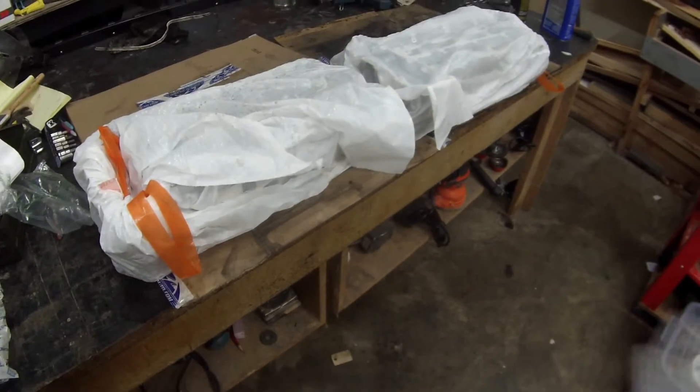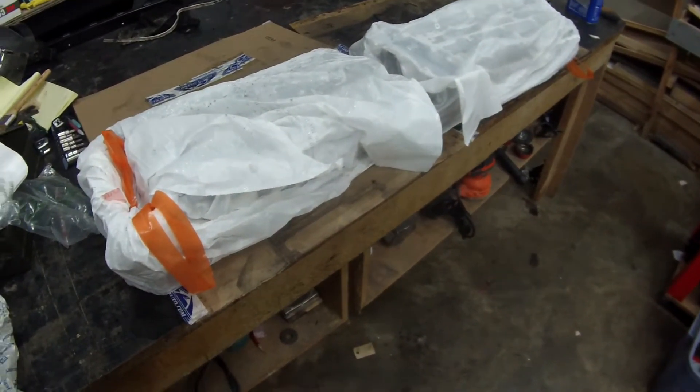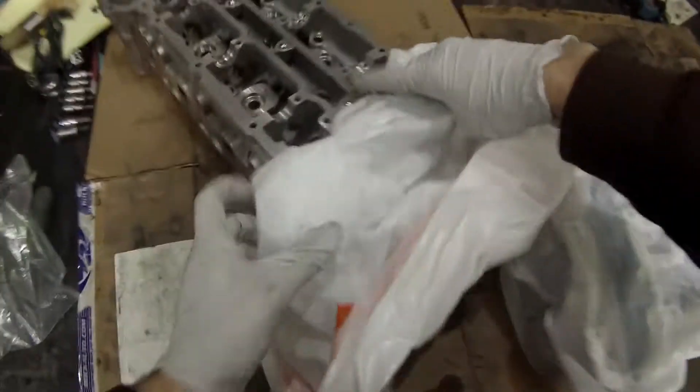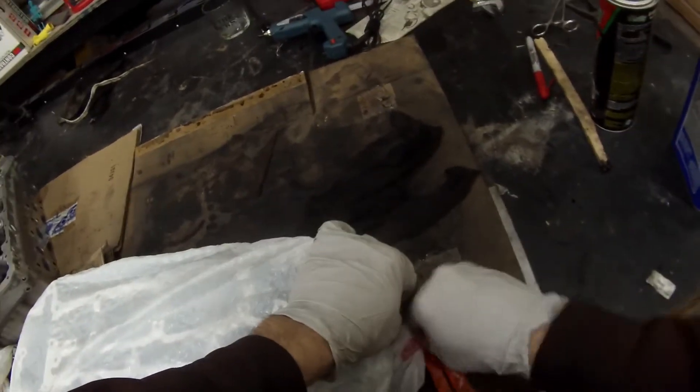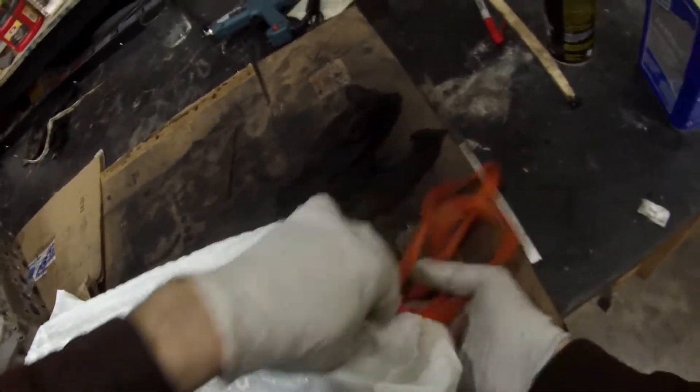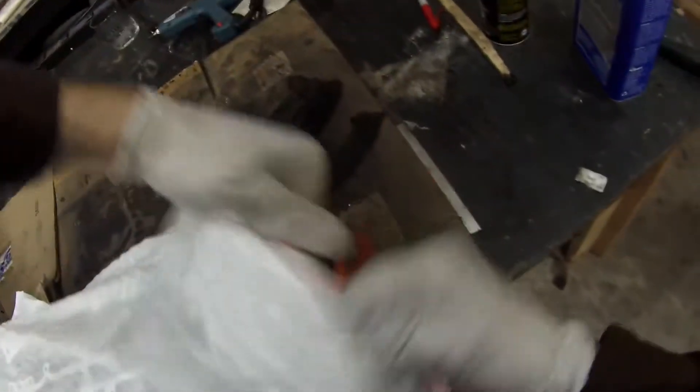But the next exciting thing to take a look at is in these bags right here. I took these home where I've got my wash tub. I use a lot of Simple Green and a lot of really hot water, keeping them rinsed — Simple Green on aluminum is not so great, so you can't let it sit on there, but it was very successful using some scrub brushes, a lot of time, a lot of Simple Green, and a lot of hot water. And those, believe it or not, are the exact same heads that I was just disassembling. These things look almost brand new — they're so shiny. All the mating surfaces are cleaned off, the ports are all cleaned out, there's no carbon gunk, nothing left in there at all. They are pristine — you could pretty much eat off of them. There was a lot of labor that went into cleaning those, so you're going to take a long time doing it, but it will be worth it. I guarantee it.